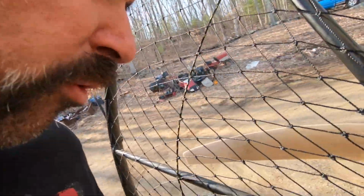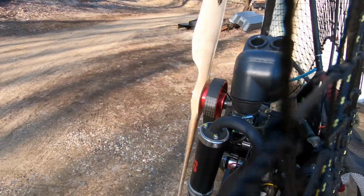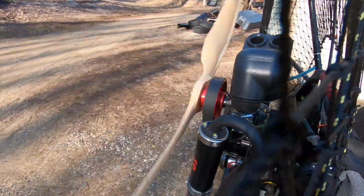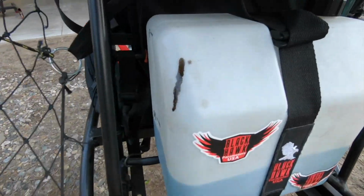So what I've been doing off camera is playing around with the mixture screws. We haven't quite got it right yet. It's idling a little low, which tells me it's pig rich. Careful. Stupid thing was recording that whole time. Wonderful. She's running rich for sure, as you can see by the spooge. So I think I'm going to leave it there.